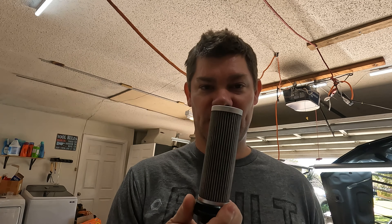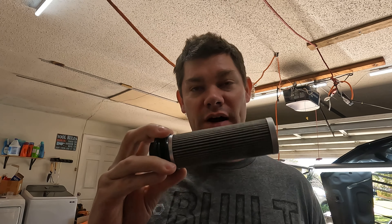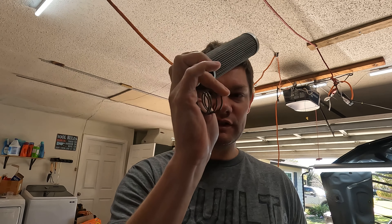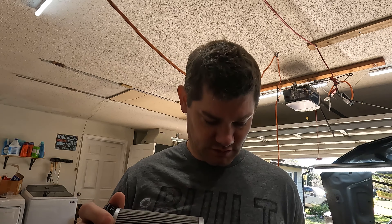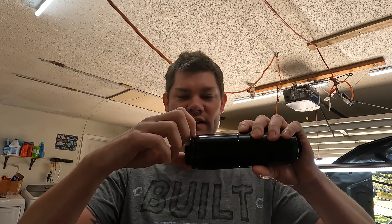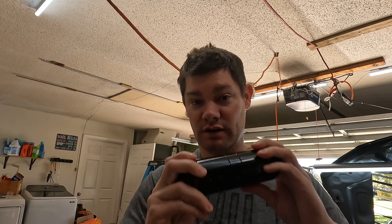This is their 120-millimeter fuel filter. Pretty simple product — one inlet and outlet. You screw it inside and you have your filter element. In this case I went with the stainless steel micro glass. There are three levels: a regular filter which is cellulose-based, then this micro glass stainless steel one, and then an upgraded reusable one. This middle one is supposedly the best for most needs. You have the filter, a spring goes inside, pop the element in with a little pressure and lock it up. It uses — I'm going to forget the word — Viton, I think. It's a special type of rubber for the seals so they don't get damaged by ethanol and other stuff. Close it up, tighten it up, and there you go.